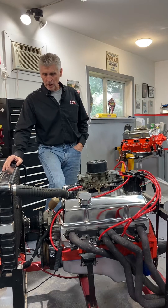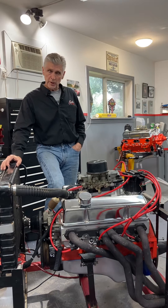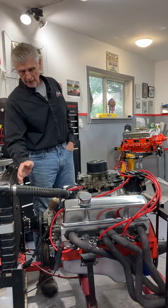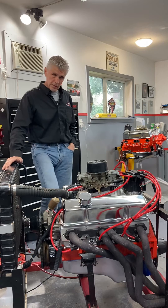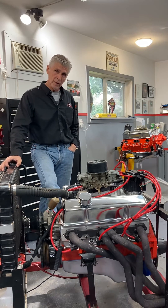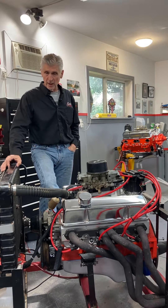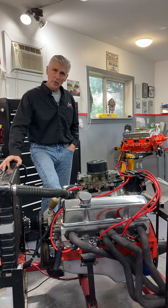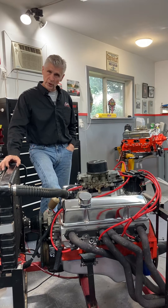It's to talk about and follow up on the issue of my previous video, which I just published a few days ago - the fact that I bought brand new, beautiful AFR Avenger 200cc heads for this engine. I did a leak-down test on them before I installed them permanently on the engine and found some leaking valves. When I published that video, I basically left it as a dilemma of what to do.